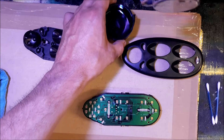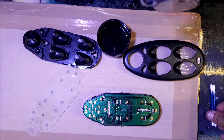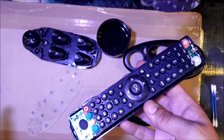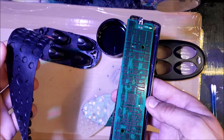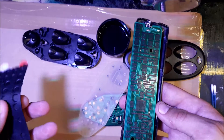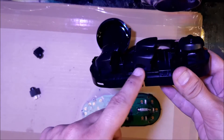I'll show you the remote control quickly because I'm going to use this opportunity to clean that up as well. What we do is clean the circuit board with a little bit of isopropyl alcohol, some cotton buds, and also clean all of those little contacts on the rubber membrane. We've got some isopropyl alcohol in the top of an old spray can lid, a soft microfibre cloth, and some cotton buds. I've split the remote apart and you can see the membrane with buttons and the circuit board — very similar.